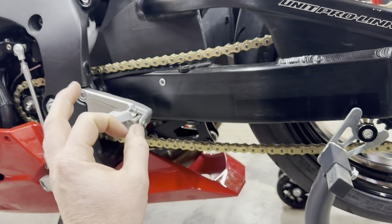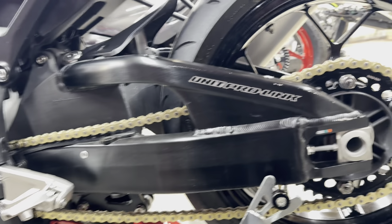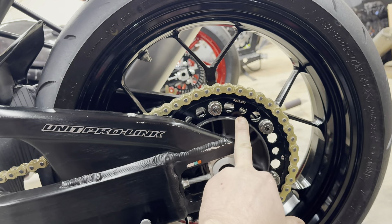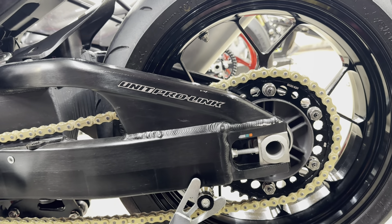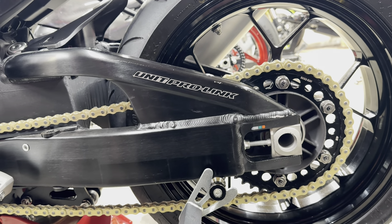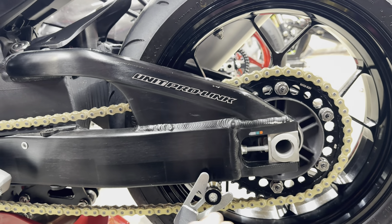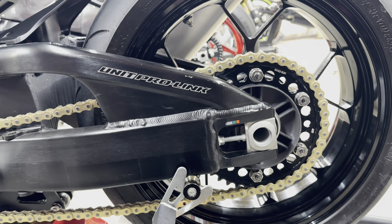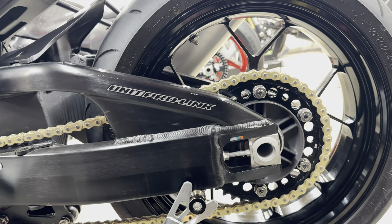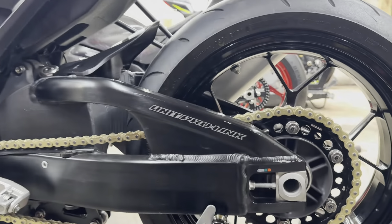I said, okay, what if we use the 16-tooth? A 16-tooth is smaller in diameter than a 17-tooth — so that means lighter weight, which is a good start. But we've got to get the gear ratio way down. A 42-tooth rear is way too much. Take into consideration: a 16/42 would be the same as a 17/45. And a 17/45 on a stock wheelbase is probably going to do a spin-a-rooney — not what we want. Big Country does not want wheelies; Big Country wants to go fast with this CBR.